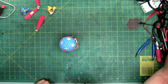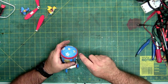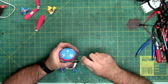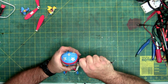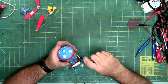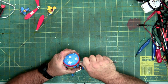Yep, that's toasty. Alrighty. Now, let's hey, it's starting to lift. I can get the spudger under it. I'm using the rounded paddle spudger that's tapered at the end. The pointy one wasn't really digging into it, which is weird because it's pointy. I am not prying. I am just pushing in and letting the wedge do all the work, because I'm trying my hardest not to damage this.